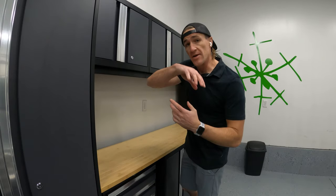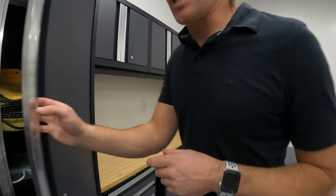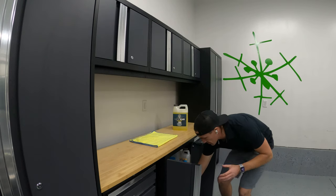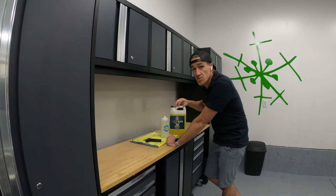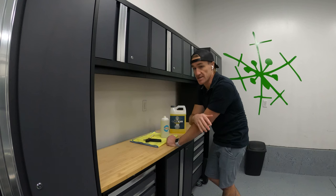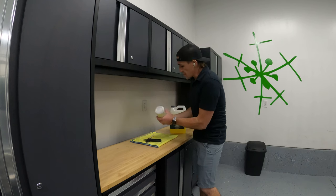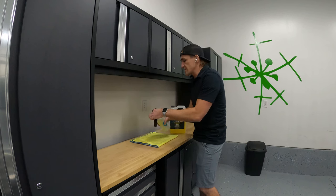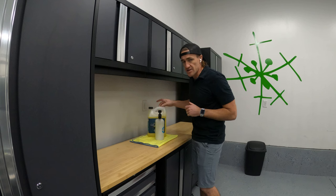With the wheels and tires done, we now need to rinse and then of course wash the Odyssey. We're gonna do the washing today with Clean Slate from Chemical Guys. The reason that we use a stripping shampoo like Clean Slate is because we want to remove any potential paint protection that the Odyssey has on it, because we are going to apply our own paint protection, and we want to make sure that it doesn't conflict with what is already on there. So let's get to rinsing, and then we will get to washing with the two bucket method. And I think it's gonna turn out really sick.